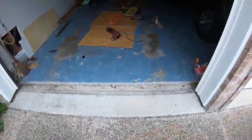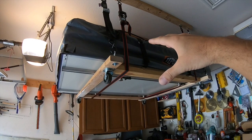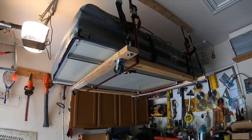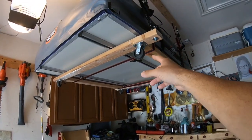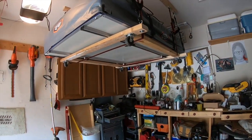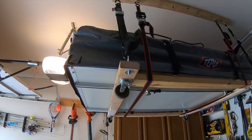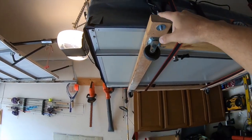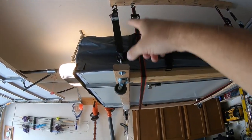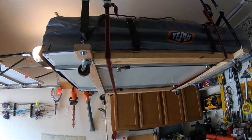On the tent side, I came up with this configuration. I wanted something I could work under and walk under, elevated up to the ceiling. So I built a square frame and put some wheels on it, so when I bring it down I can wheel it out to the jig to lift it up and hoist it. On the four corners I put these motorcycle straps. I'll put a link in the description below if you're interested in those. The reason I wanted these is that they're each individually secured, so the likelihood that two or more are going to fail at once is very unlikely.